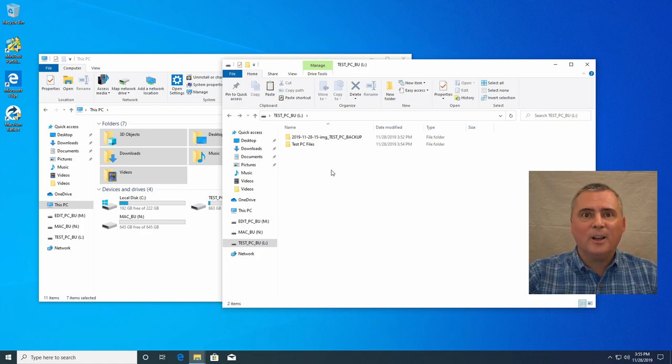By the way, when you take your image and clone it back onto a drive, it has to be the same type of drive if you're going to use Clonezilla. That is a limitation of Clonezilla. If you want to go from a hard drive to an SSD or an SSD to a hard disk, you're going to need to use a different program. Clonezilla images can go back onto the same drive you copied from, or in this case another SSD since it was copied from an SSD. Windows doesn't like going from SSD to HDD or vice versa without special steps, and Clonezilla is not set up for those. So I recommend restoring to the same type of drive it came from.